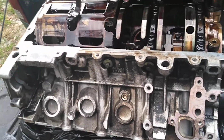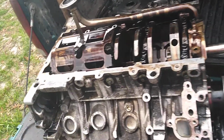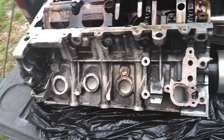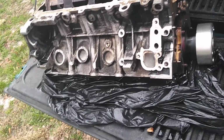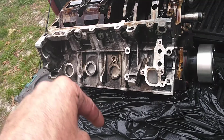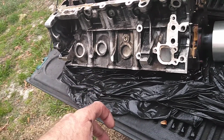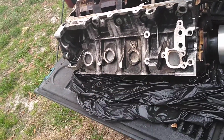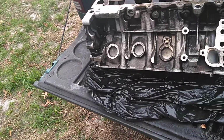I don't have the tool, so what I'm going to do, there's a trick, and I'm going to put that in one of my next videos. I don't have a vise to take it out, but I'm going to try this trick on one of them. If it works, I'm going to take all of the spark plugs out of the heads. They go deep into the head, so you don't have easy access to them. Ford makes a special tool to remove them. This is a common problem with 4.6s. But this block will hold a lot of boost.